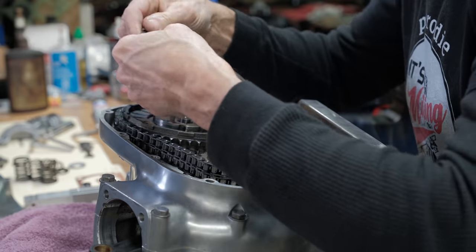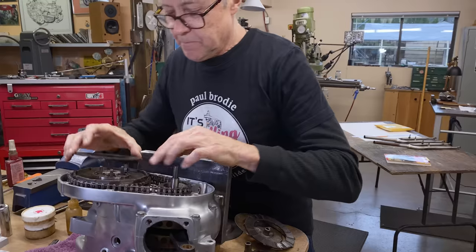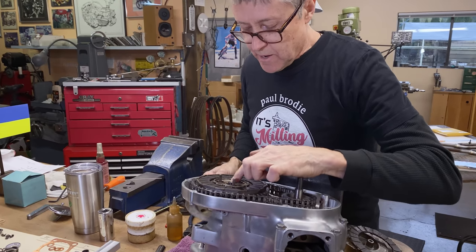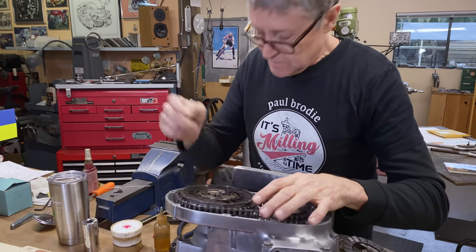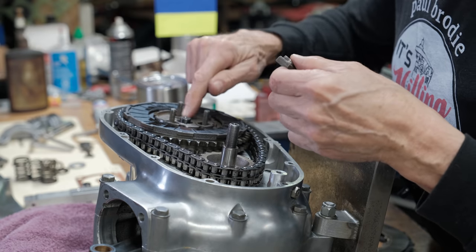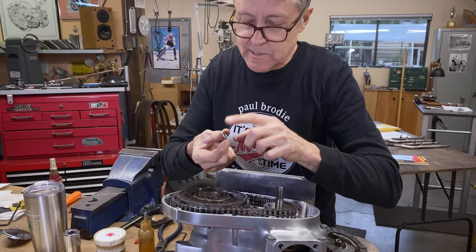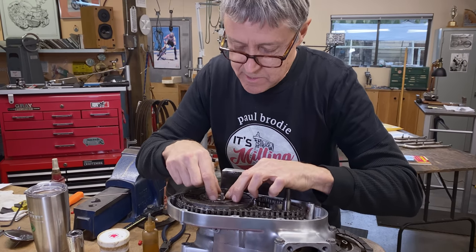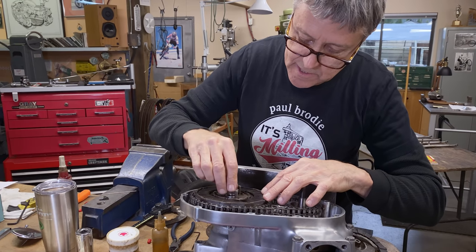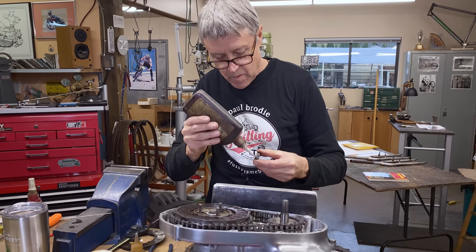Apparently this goes one way like that. So what I have to do now is put the nut on there — you need space because these hexes hit those three exposed tubes, so I made up a special washer. We'll put some blue loctite on this, seeing as how I'm told I'm going to be taking it apart for sure.